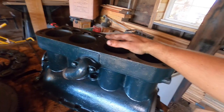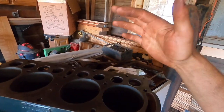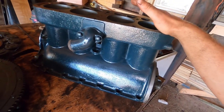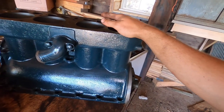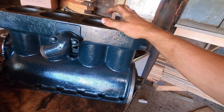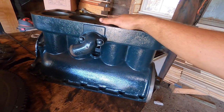So for the game plan going forward, I am first going to hone the cylinders. The cylinders need to be honed with a crosshatch pattern to be able to accept the new piston rings and get a good seal. Then I'm going to fix the third main bearing, and I'll explain in my next video exactly what I need to do to it. But I'm going to work on the thrust surface on it, and get the crank set.